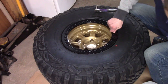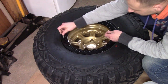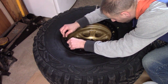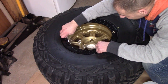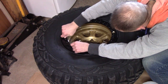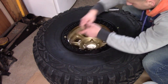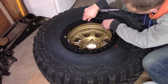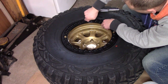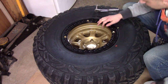To start, I like just with my finger kind of going around and get all the bolts in there. For this step you really don't need to go in a star pattern when you're just lightly getting them in. I like to kind of get one on each corner just to make sure it's lined up everywhere. Once you get all the bolts at least threaded on, then we can start using our wrench and start doing the star pattern.